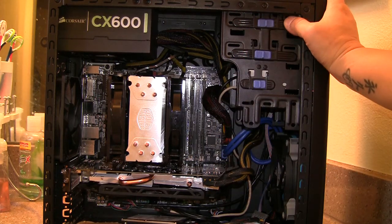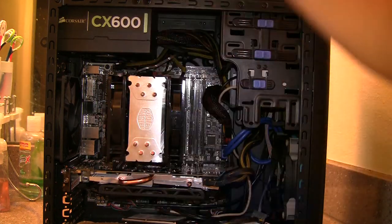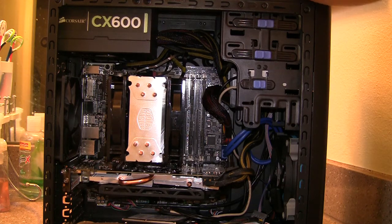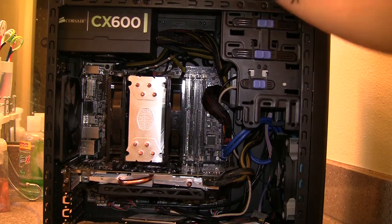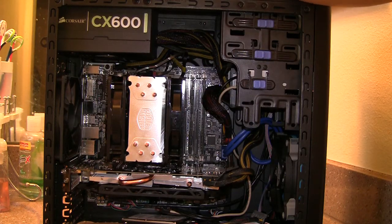The finish is not bad, but the fitment wasn't great. It got to the point where I almost just gave up and put the motherboard on top of the motherboard box to power it up. It was hard to put in the rear IO plate and line up the motherboard onto the standoffs. It was so tight inside that I actually had to take off the rear fan just to fit the motherboard in without scratching it. I suggest taking off that fan before installing the motherboard in this case.